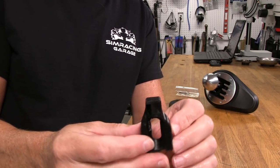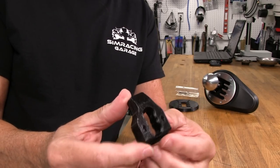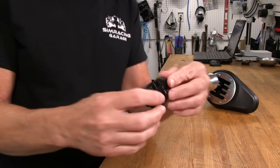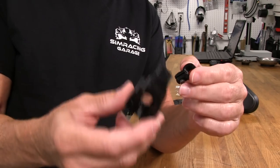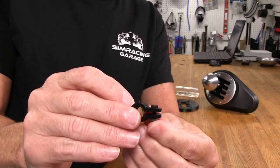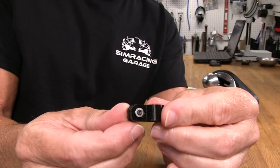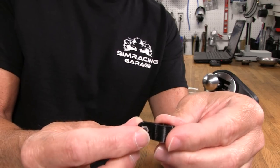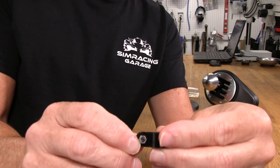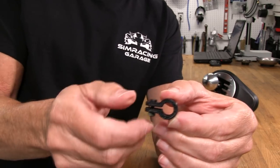On the front it's just a blunt surface. It's got a couple of arrows pointing up to make sure you know which is the top portion and that it should be facing towards the front of the shifter. We also have this locking ring that's going to slide down on top of it once we have it installed, and then we can tighten that down with a 2.5 millimeter socket cap screw. They've cut into this 3D printed piece a slot that will accommodate the nut so the nut won't turn — you don't need a wrench on the other side.